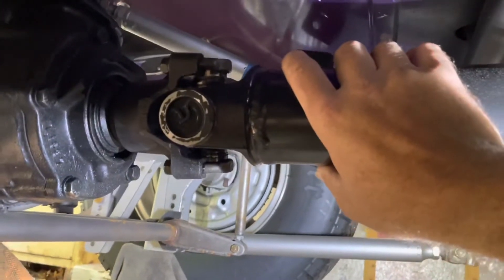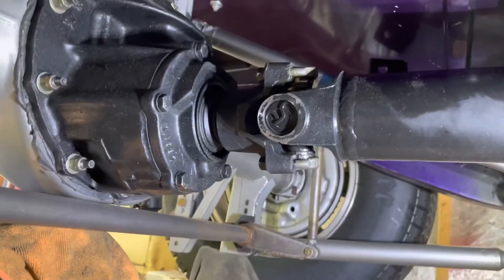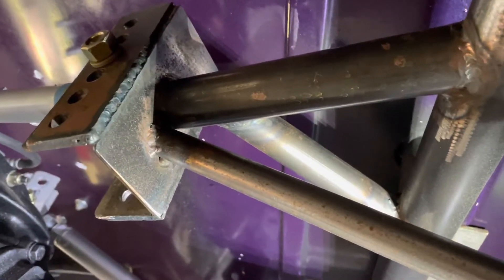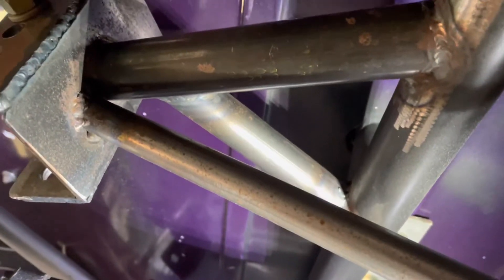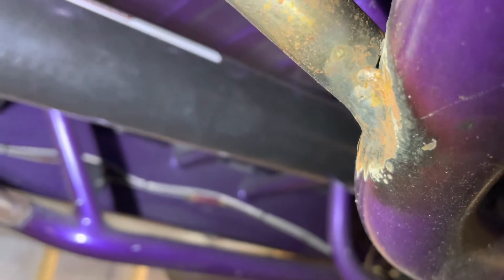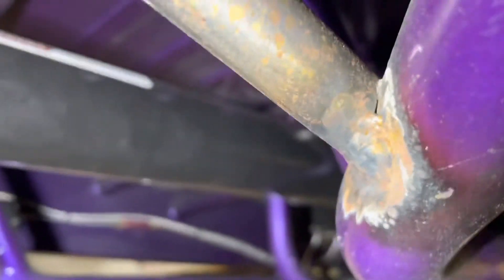Big, big, big plus. Now back at the rear — straps are tight, u-joint didn't have any play in it, another great big plus there. I've been going around checking all the welds, just want to make sure nothing's cracking. That's one reason why I have not painted any of this since I got it on there — I just want to make sure that everything's going to be okay.